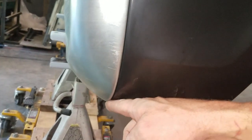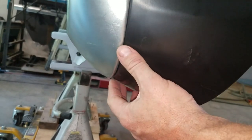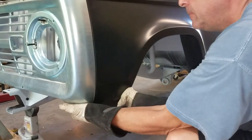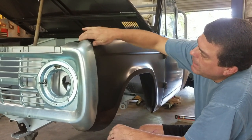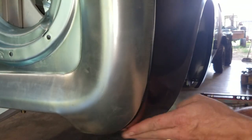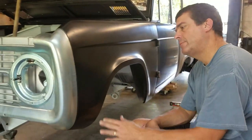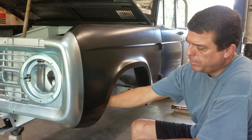I'll let Joni come around here and you'll see it. You see how my fender is starting to dive in behind it, and then the grill is actually higher. So what I have to do now is pull the fender back out and tighten this bolt down. This is about as good as I could get it to fit. This will be pre-filler. So you can see it's got a little ridge at the top, but it actually rolls with this fender. You guys got to remember, these are aftermarket parts built by different companies, so the fit's about as good as you're going to get — it's not going to be any better. Then you have some little support struts that go under here too, but I'm not putting them on yet.